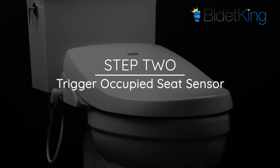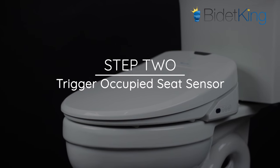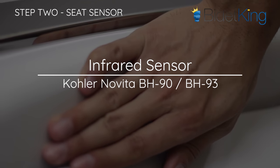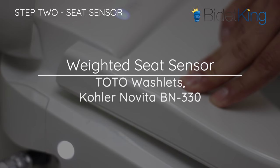Step 2. Trigger the bidet's occupied seat sensor. All bidet seats have some sort of occupied seat sensor. This prevents the seat from spraying while no one is seated. To make testing easier, we're going to trick the seat sensor into thinking someone is seated. Most bidet seats on the market use a skin sensor in the 4 to 5 o'clock area of the seat. Some models have a sensor in a different area, and some have their own unique method, like an infrared sensor. Toto washlets use a weight sensor.